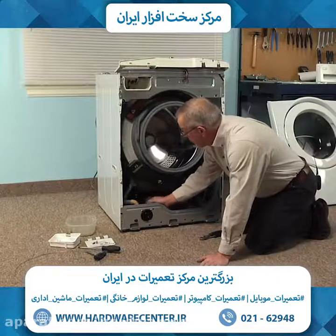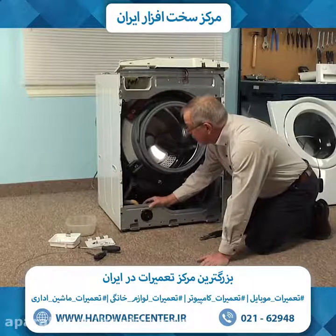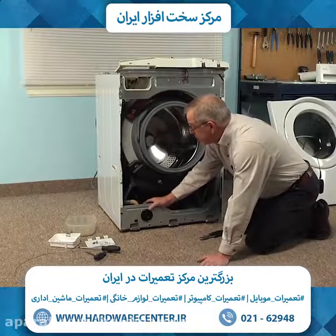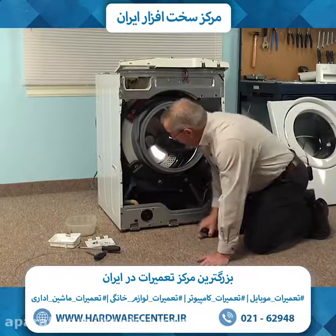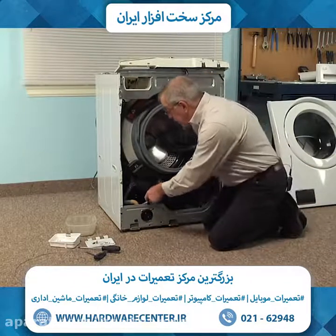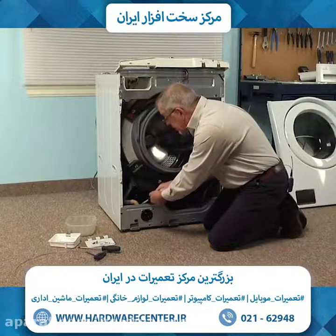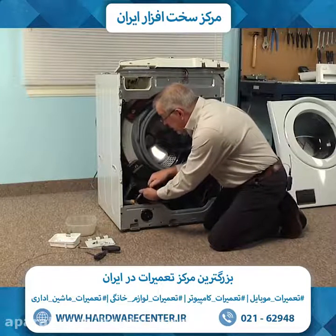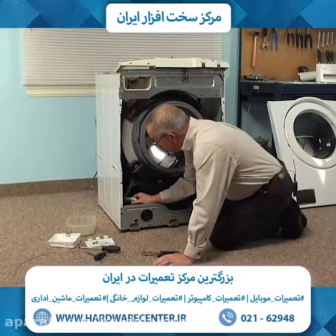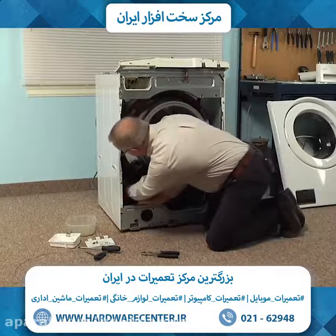The drain pump motor is located on the left side of that drain pump, and depending on your model there may be 2 or 3 hoses attached to that drain pump, and it may be secured to the base with 3 bolts or with a little sliding locking tab. So the first thing to do will be to remove the clamps on those hoses. Just squeeze them with the pliers and then twist the hose free. And there may still be some residual water in these hoses.